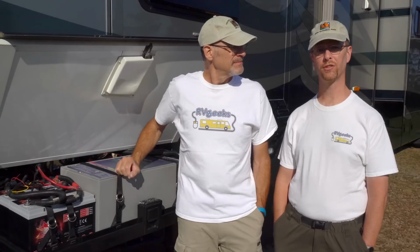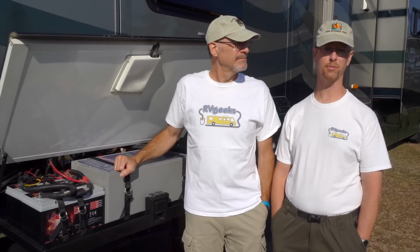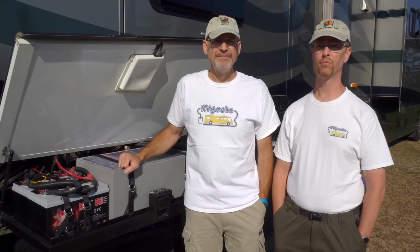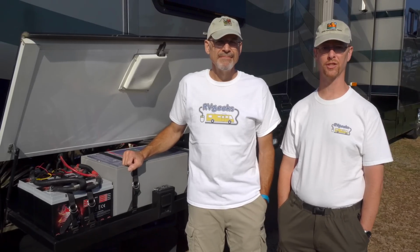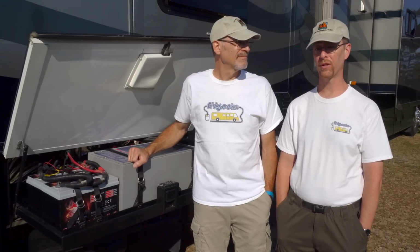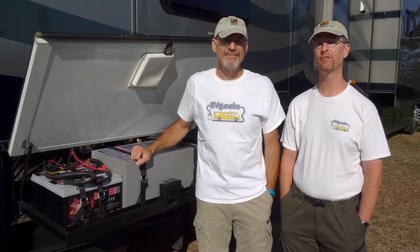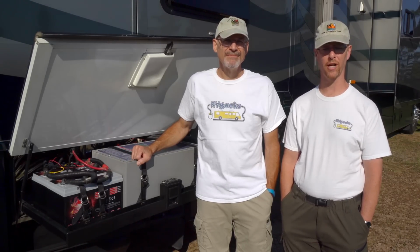Right, so while it's measuring that load, measuring the amount of power you're pulling out of the battery, it's not capturing all of it, and therefore you're misrepresenting the actual state of charge on the battery. You may think you're at 60%, but because of other draws that were not being pulled through that battery monitoring kit, you're actually at 50%, and you could then damage your battery without realizing it.